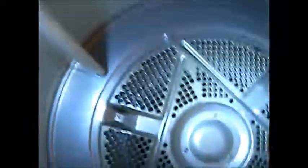So this has a main bearing right there in the center — right here. Don't mess with this on this side. You can see that black residue there. Black residue on there indicates wear. And what happens is these things get stuck. So what you can try and do is wedge something in here — make sure the belt is disconnected first — wedge something in here and push up to see if you can get it loose.